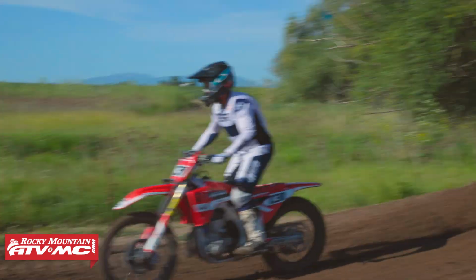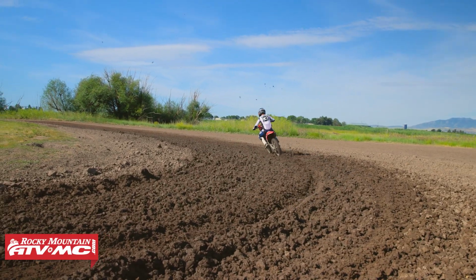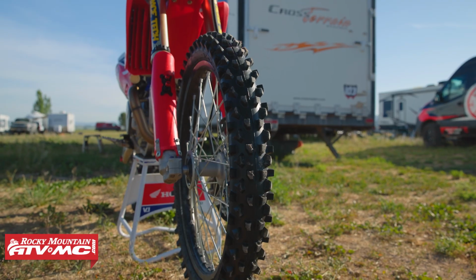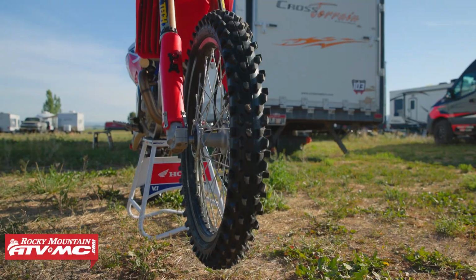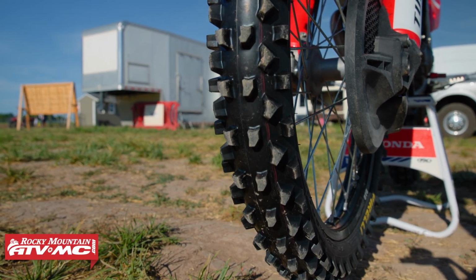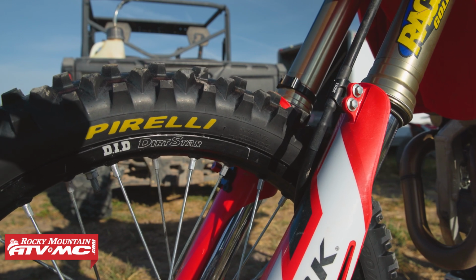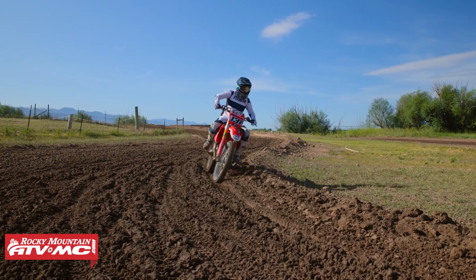And so that's what this tread design is designed to do. It gives really good forward drive. If you look at the side lugs, they do have little cutouts in them. That's just to help give more biting edges when you're really leaning the bike over. And then in the front, kind of interesting, you notice that they don't have any lugs going down the center of the tread. The reason for that, they say, is that having the two lugs spread out gives better compliance and bump absorption, because you're not trying to spread the entire load onto one single knob. It's going to spread that out over two. And then they increased the size of those diamond lugs on the sidewall, which has been a thing Pirelli's done for a long time. That's just to help cut through the dirt and give good lean angle traction.